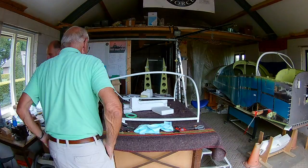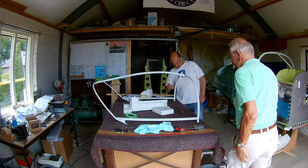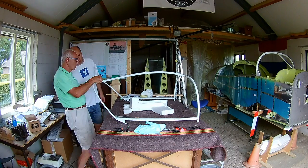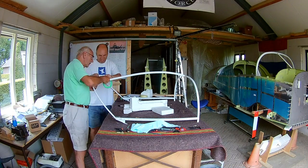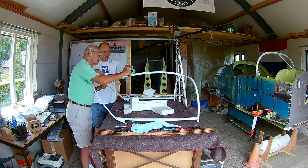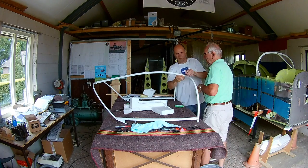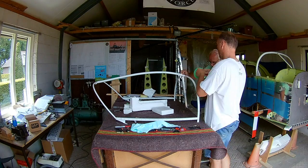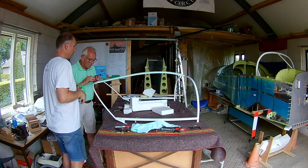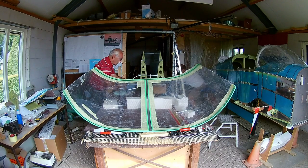I want to keep the frame white. I know there are other builders who paint the frame black, which is not a bad idea — because then if you spill something with either the Sikaflex or the primer you don't see it. But I decided to keep it white because I like that. So we also use the fine tape on the frame. You can actually see the flexibility of the canopy bubble here — it almost looks flat. You have to be careful there because it can break.